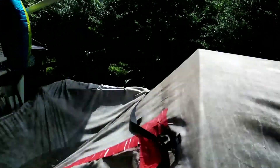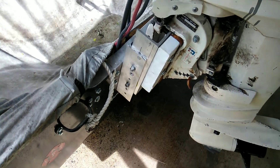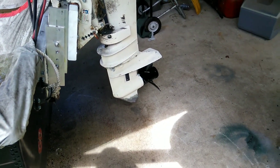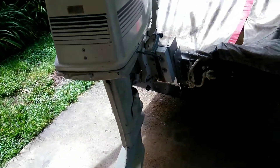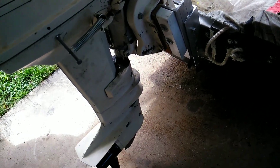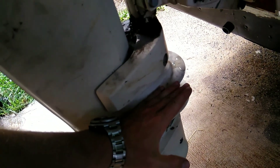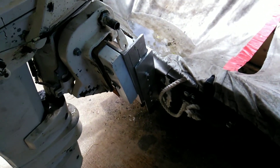Look at that steam coming off of it. My most recent project — within the past two weeks — I've been reading about motor placement in the water and where it runs most efficiently. What I found is that my 20-inch shaft motor was definitely not at the most optimum place in the water. It was way too deep before; the water was right there while it was moving. So as you can see here, I made myself a little jack plate.